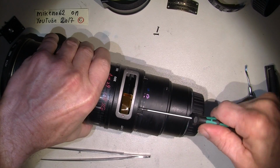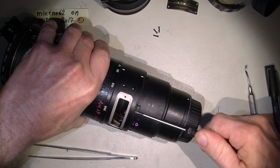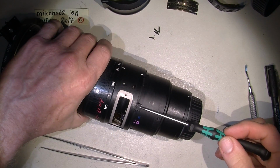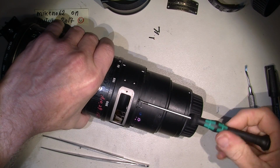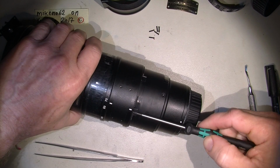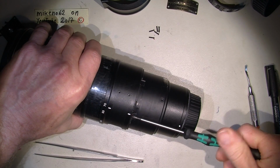It works pretty good. If one screw is really stuck and you cannot get it out, add a little more nail polish remover. And be sure the screwdriver fits perfectly in the screw head. Therefore I file my screwdrivers now and then so the tip will fit perfectly. Because if you try once or twice and cannot get the screw loose, you maybe have a problem.